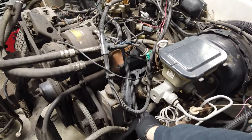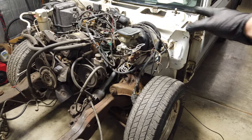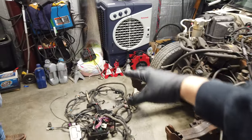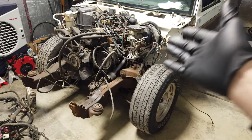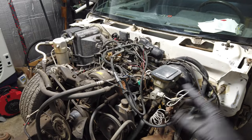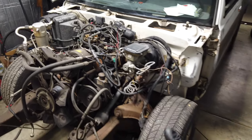Now that it's all kind of cleaned up, we really just need to get in there, undo the engine mount, undo the transmission mount, and hopefully just grab onto it and lift it all out straight and get rid of it. That's just pretty much junk. The engine that was in it — the guy told us too little oil or too much oil or something — and it ended up spinning a bearing, so I'm going to go with probably too little oil.